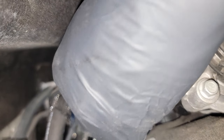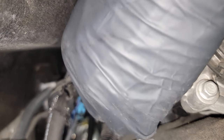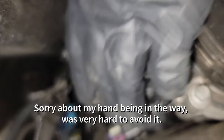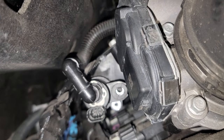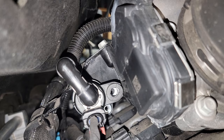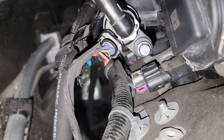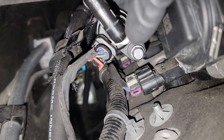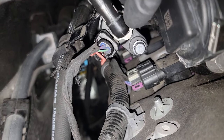Now that it's in, we're just going to plug this in. I'm going to push this clip up, and now that's on there. Grab the little plug, put that in there. Now we just got that 10mm bolt — new bolt in. It's just hard to film while my hand was in the way — it would block it the whole entire time. New bolt in, now we're just going to tighten it down real quick.